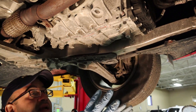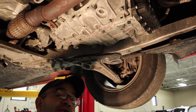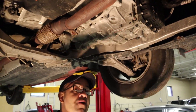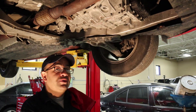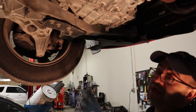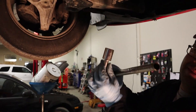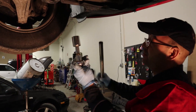After that, we can measure how much transmission fluid you took out, and that's what you're gonna put of brand new transmission fluid in. I'm gonna open the drain plug — it's gonna be a 21 millimeter socket with my half-inch ratchet.